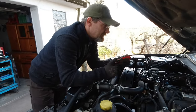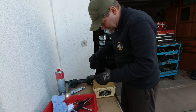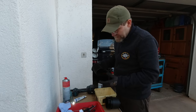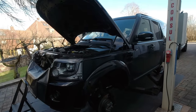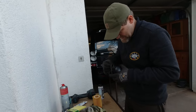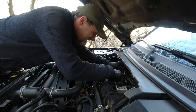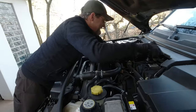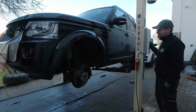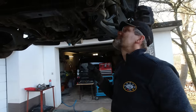We can put the oil filter in while we're here. Of course we're going to change it — it has chips inside now. Beautiful, no chips whatsoever — so we're going to keep this filter in a plastic bag. That car is for sale, not on sale. New oil filter, new O-ring. Now the filter goes in here on a four. Now we're done in the engine bay. We're going to put in the starter motor.